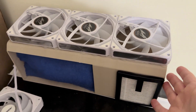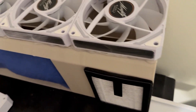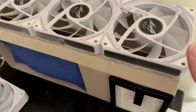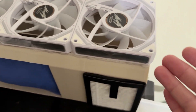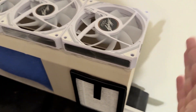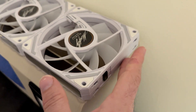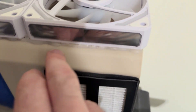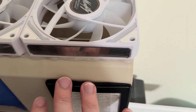Hello fan lovers and lovers of clean air. I did a short on making my own kind of HEPA air filter system, and I want to talk about processes that have gone through it and lessons learned. I've made one where the fans sit inside, and that one is significantly better than this one. I needed to glue the outside in order to seal these fans to it because of warping with 3D printing. So that is the first flaw in it.